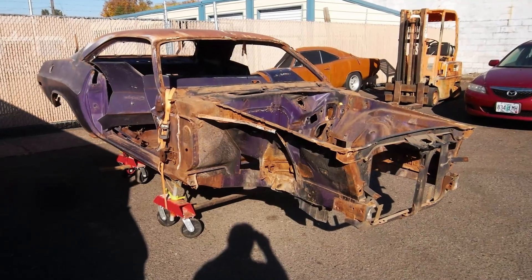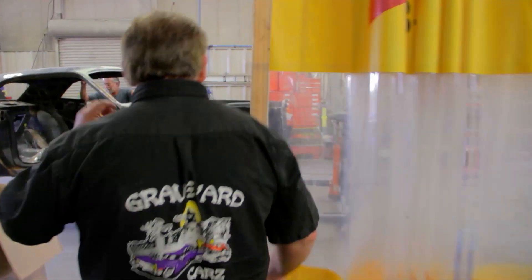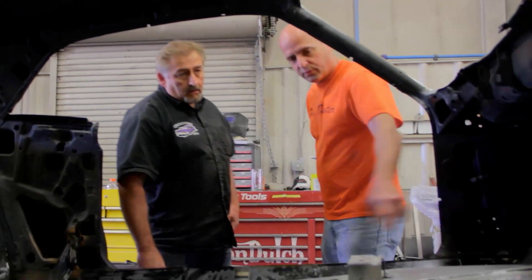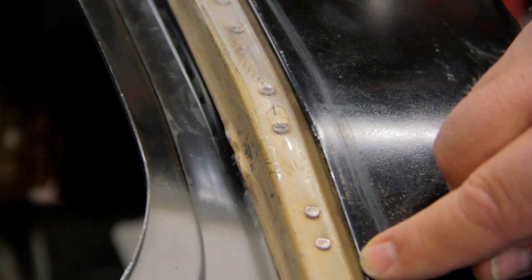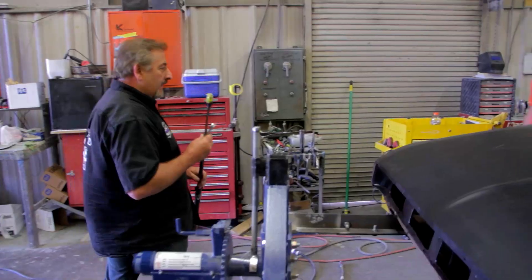In the end it is a really, really clean job, and it is necessary for a rusty car. The importance of pre-fitting panels before you even start doing your first weld cannot be understated. The duplication of the spot welds — I don't know on an everyday driver car if it's important to have the exact spacing, the exact depth, the exact appearance. I think it's important to spot weld. The factory spot-welded for a reason, so we do it because Chrysler did it. We try to emulate it the way Chrysler did it.